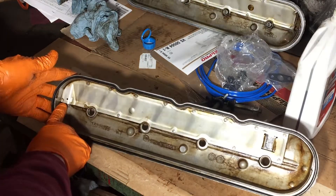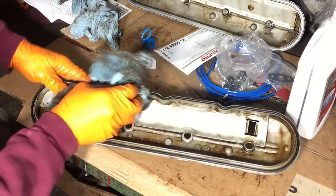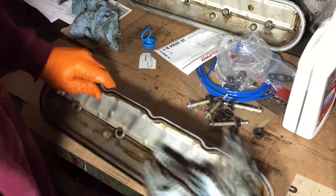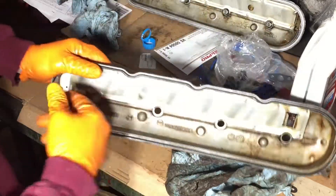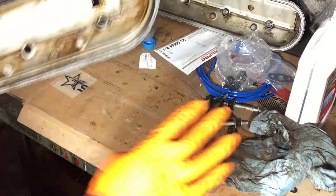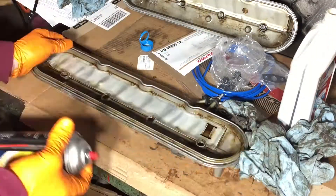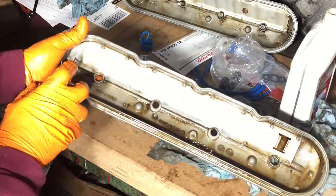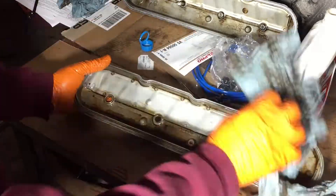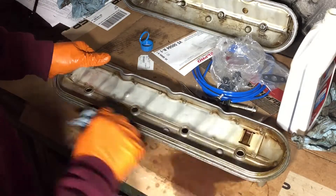This little hole is not plugged up, but it doesn't hurt to do some flushing while it's out here. There's some yuck in there. The best way to get behind this baffle is to use brake clean and the straw — that way I can get a bunch of brake clean back there, slosh it back and forth, and rinse out as much as I can.